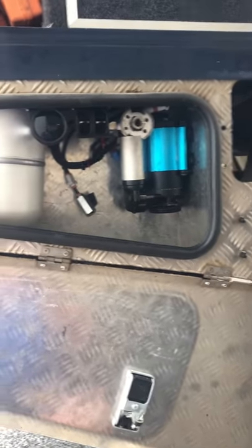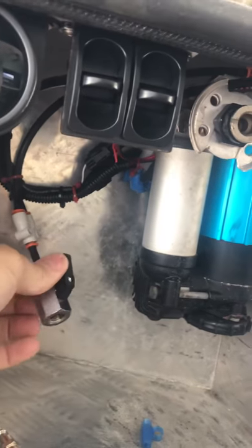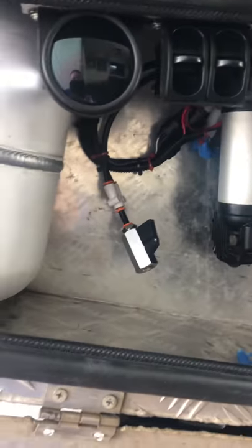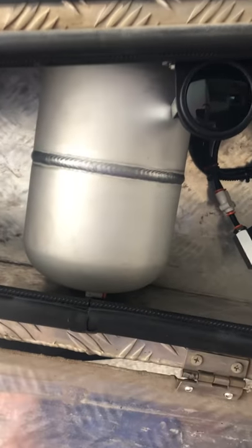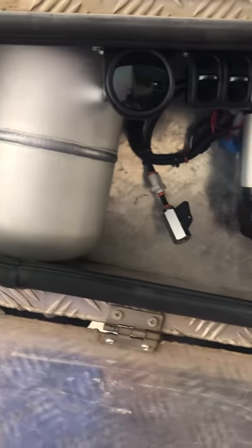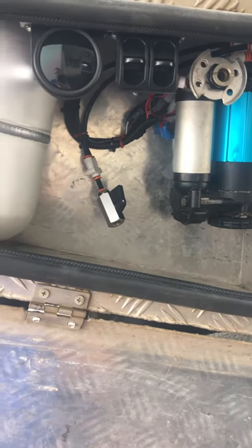What I'm working on at the moment is an air tank installation. I've got an air tank here which I bought from ARB. I've put some right-angle fittings into that already. I've got a shut-off valve here — I'm going to isolate the airbag system and the pneumatics from the air tank and the rest of the air supply that I'm going to install.